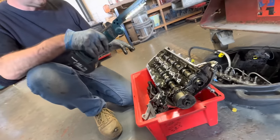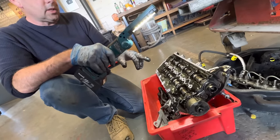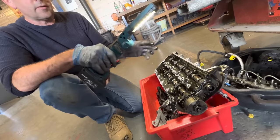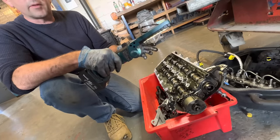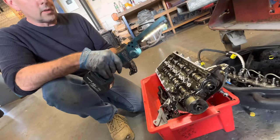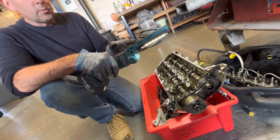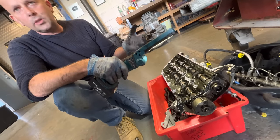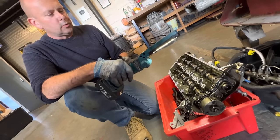It's hard to know what has happened. As that pin sheared, but if that pin is sheared, the bolt should still hold it. It's only a pin just for assembly purposes. It's not a drive pin like a Woodruff key. It is purely just for the purpose of assembly. So I think it's more likely the bolt came loose and then all the load is on that little pin, which it can never take, and it shears. So I think it's most likely that.